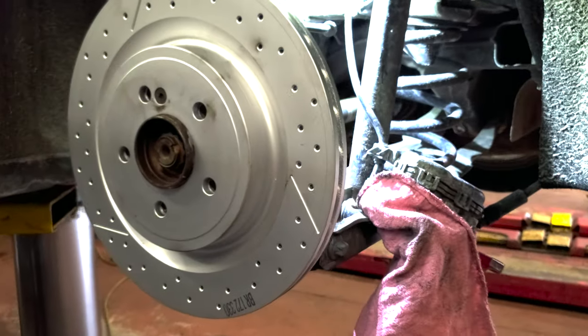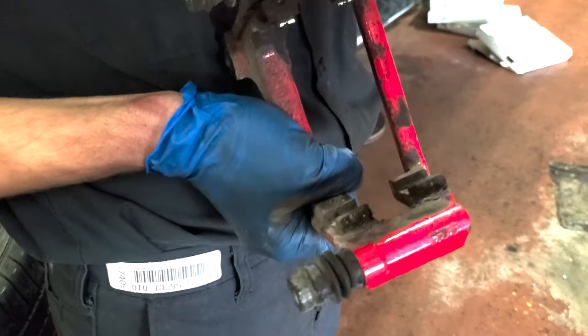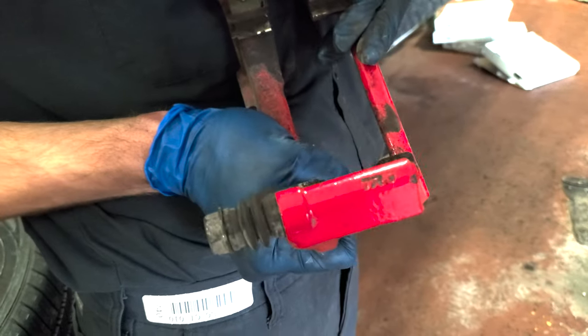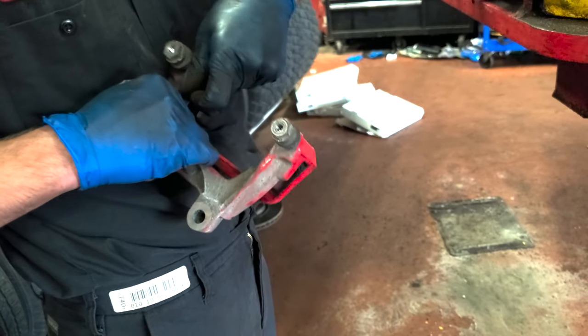2015, 2020. And now we're gonna put the bracket back on. Actually, we're gonna do the caliper service first. You're gonna clean that up, put new lube in the sliding pins. Are they good or do they need service? I checked the other side, it was good. Awesome. Move this one in and out. Let's take it. See the old shims.